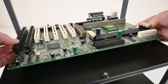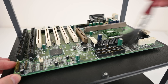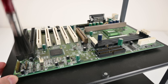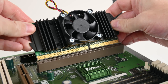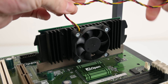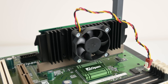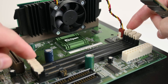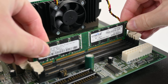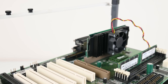The Celeron gets you an entry-level processor with affordable prices and modest performance aimed at everyday tasks. In general, with most Celerons you will get a lower frontside bus, a lower clock speed, fewer cores, and also a smaller cache. Level 2 cache is high-speed memory located close to the processor, storing frequently accessed data to avoid grabbing information from the much slower system RAM - the more cache you have, the more performance.